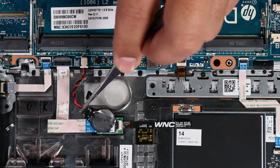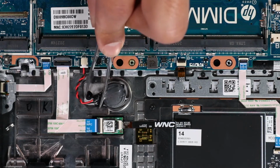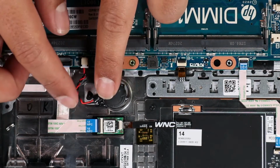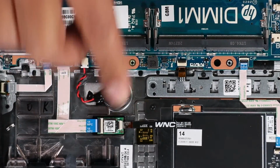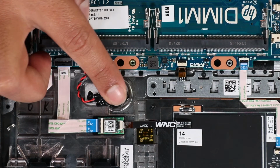Place the RTC battery in position on the top cover. Press down on the RTC battery to adhere it to the top cover. Important: after a system board replacement, be sure to complete post-installation tasks as required that may include verifying functionality of the notebook, updating the BIOS, updating DMI and other settings.